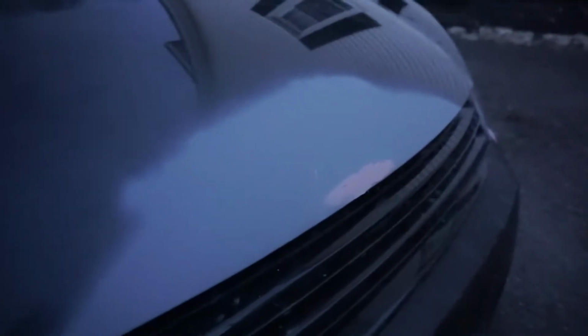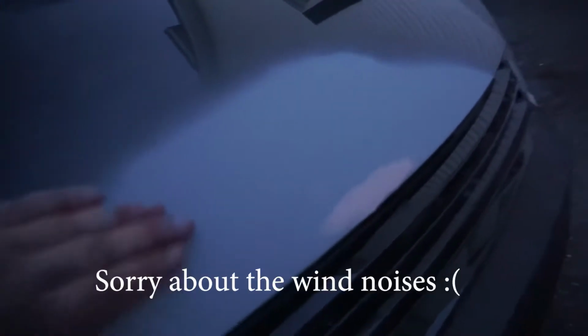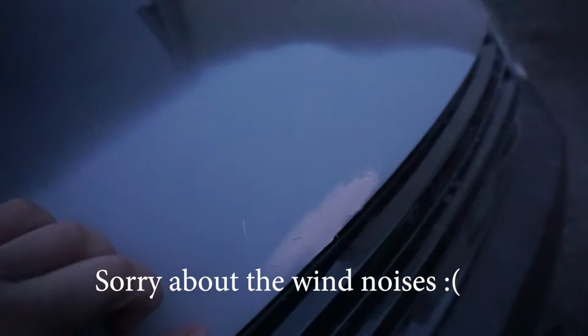So yesterday I left off. I sanded all that down. I actually got it pretty nice and flat. I'm sorry I didn't film it. I'm working on a time crunch here. I sanded it and I just primed it so it doesn't rust. So that looks good. And then I put a little Bondo filler over some little pits.